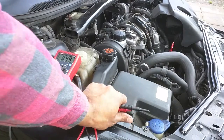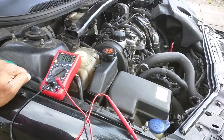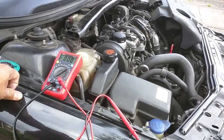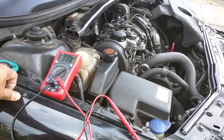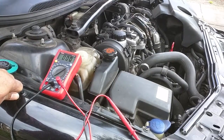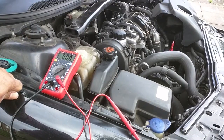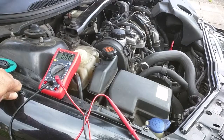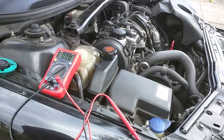So even though the coolant passes the basic freeze test — it won't freeze, and because of the mix strength it will stay stable over 100°C — and it's clean and clear, that final voltage test it's failed quite miserably. I'm going to change the coolant on this car and then show you the test again afterwards to see the difference with fresh coolant. With those three very simple, quick, and cheap tests you should be well on your way to working out whether you need to change your coolant or not. I hope you find that useful, thanks for watching.